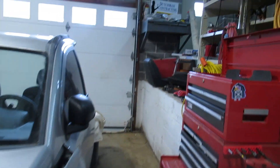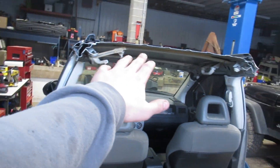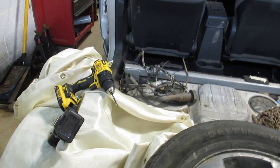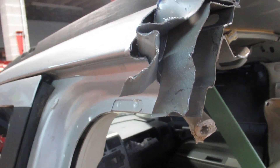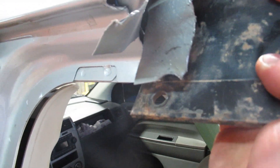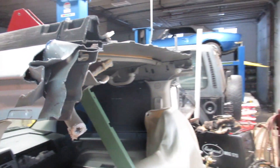Somehow we got 16 to 17 inches of snow, but I'm going to have a bar coming across right there, and then two diagonal bars coming down around the shock absorber area. The blanket's here because the fuel filler is right there. Before this bar is welded in across the top, I'm going to wedge this in here so I can weld to that — it's hard to get a good strong thing going across.